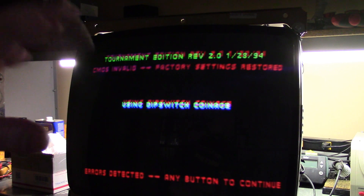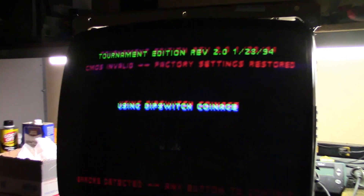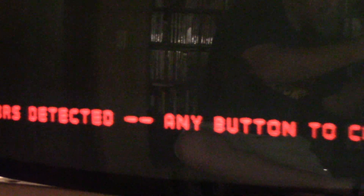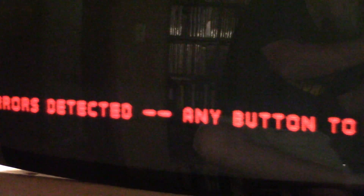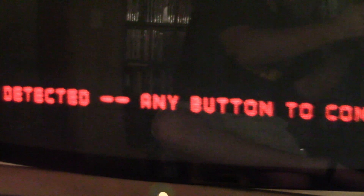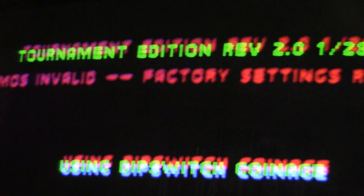But the purpose of this is about convergence. If we zoom in here you can see how very off it is. There's a good example here — the bottom is only red. You can see it's out of focus slightly and only red, so there's no convergence. Up here it's very bad, and up top it's even worse because it's only red and yellow and there's no blue.